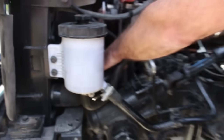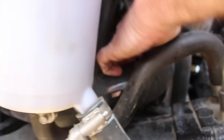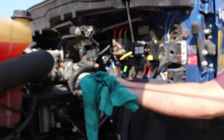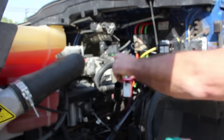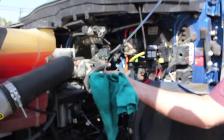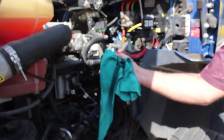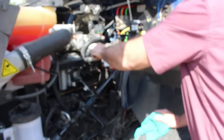Moving to the lower radiator hose — securely mounted, no abrasions, bulges, or cuts, and I don't see any leaks. I will now perform the oil test: I remove the dipstick, wipe it off, reinsert it, then re-remove it to make sure the level is above add and below full, within working conditions. I would perform the same test on the transmission.